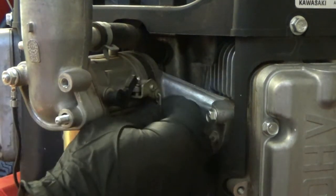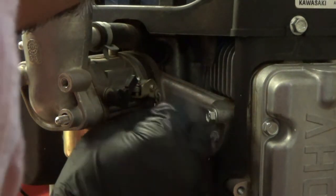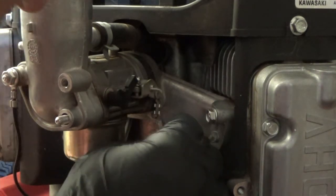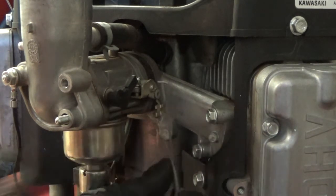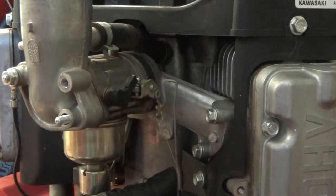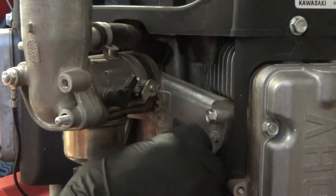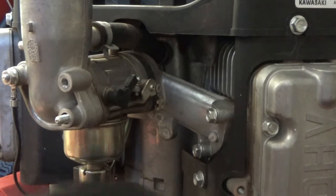So the way that works is it just pops right off and out. Oh, I see. So the spring is connected to the release. So the rod just came right out. It just sticks in there at a 90. It's not even a Z. It's held in place by the pin that the spring is connected to. So I'll disconnect the spring too. All right, that was pretty easy. It just lifts up out of the way, and I can set that aside. Yeah, not too bad.